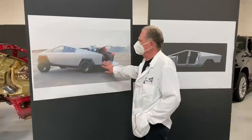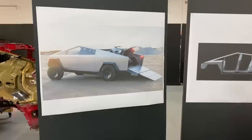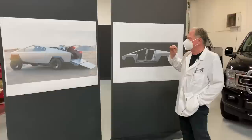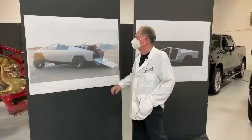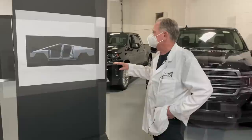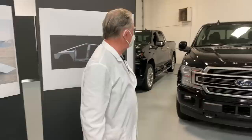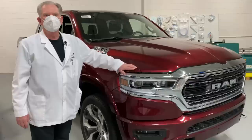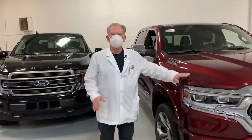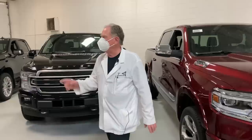The body geometry is what really sets the Cybertruck apart. These very hard, aggressive lines give it its intrinsic value and style. This is a really unique way of making a product — and these lines exist for another reason: stainless steel is not your best friend when it comes to forming techniques. The detailed lines you see on the Ford, Chevy, and Ram are absolutely impossible with a hard material like stainless steel, especially at thickness.